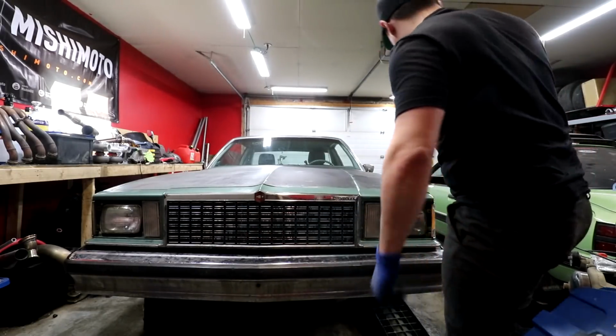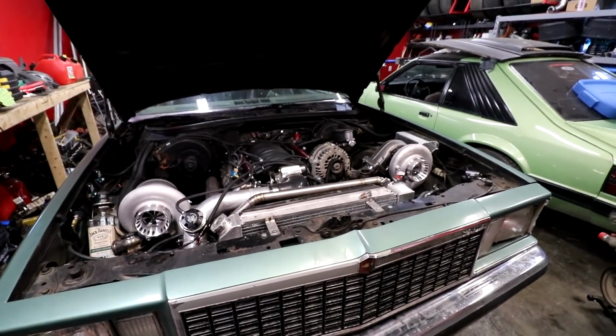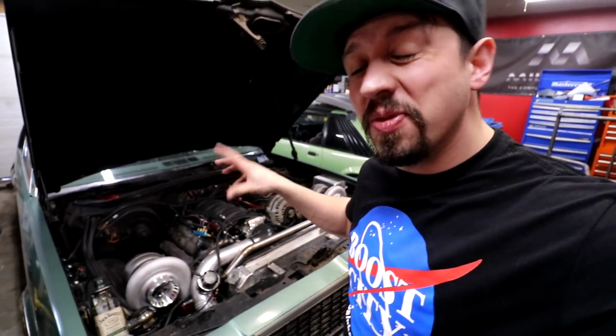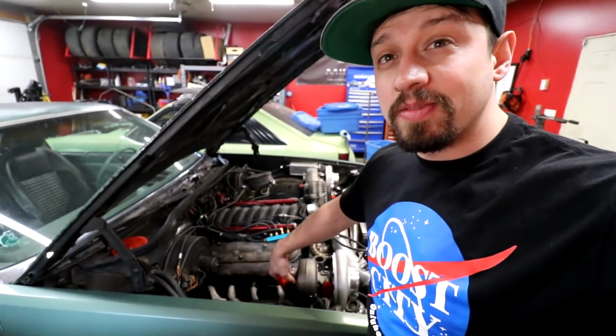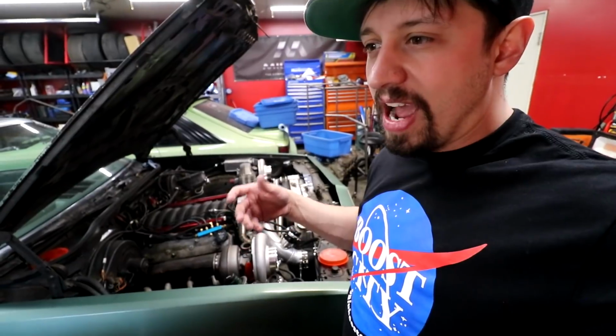I didn't want to catch that. So there we go, 2 turbos mounted, hood's cleared. So I just have to weld those manifolds up completely. I'll do that next time I come out here. The exhaust housings actually have to come off. They're like a Marmon flange, and it's just an unorthodox flange for aftermarket stuff.